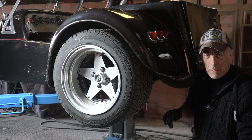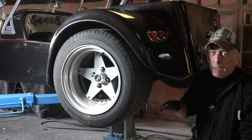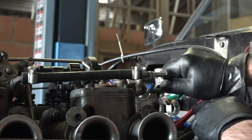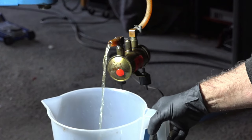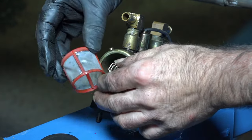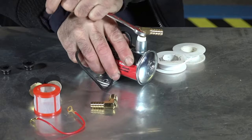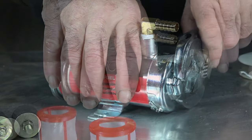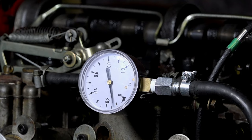Draining the fuel tank is a bit more difficult and I don't know how much fuel is in there, but that old fuel has to go. It doesn't really matter if you have a mechanical or an electrical fuel pump — if the car has been sitting for a long time, the best thing is to replace that fuel pump. In my case I replaced the electrical fuel pump with a new one. Once the pump was installed I double checked the pressure so that the carburetor is not going to have an issue, because Webers are sensitive to overpressure.